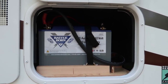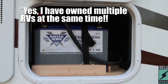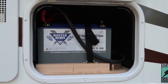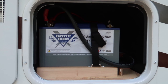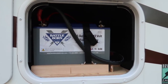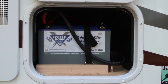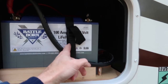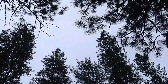BattleBorn battery upgrade — I would never have done this to this rig, but I had bought these for a different RV. In my 811 I had AGM batteries; I'll include a link below on how I did that upgrade. The physical dimensions of these BattleBorns are a little bit smaller than the Group 31 AGMs I had in my 811. Because they're slightly smaller, I was able to shift them over to the side and have space for my inverter fuse, put some wood spacer blocks between the batteries, and use some tie-down straps to hold them in place.